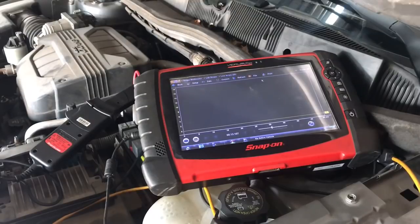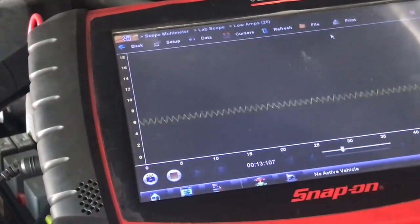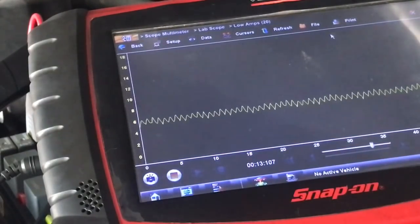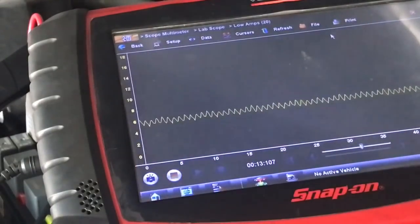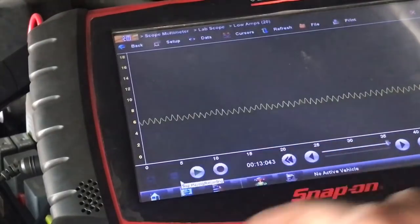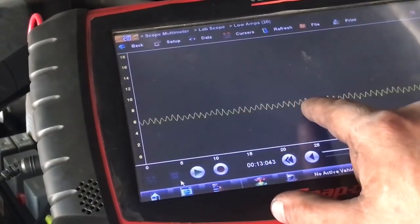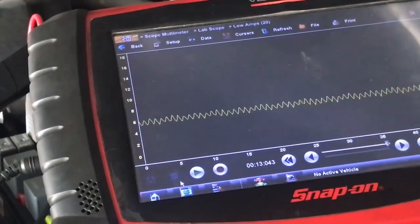We have the brand new fuel pump on. I primed it a couple times but it might be a little off, so I'm going to crank it over and we're going to look at the amperage. As you can see, we don't have a drop like the other one, and our amperage is actually a little bit lower too. All our ripples right here are pretty much sequenced. We can still figure out how many we have — counting 1, 2, 3, 4, 5, 6, 7, 8 — but we don't have that major drop that we had before.